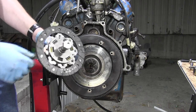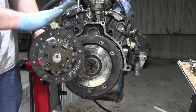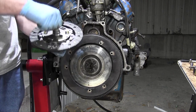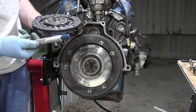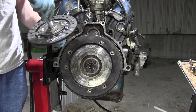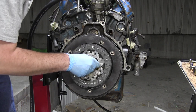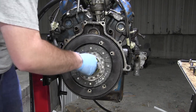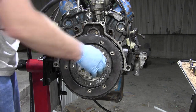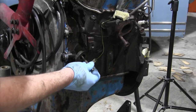And here is my brand new clutch plate. And you notice it's mounted on a bolt. Well, I have it spinning on a bolt. That's because the clutch alignment tool I ordered had the wrong spline pattern, so I hacked the end off of it and made my own clutch alignment tool. I got this bit as centered as I possibly could. So, if you can't buy it, make it. Or buy it whole, hack bits off of it, and make your own from the bits that you've hacked off. There's a lesson in there somewhere. Perfecto.